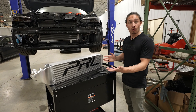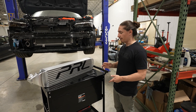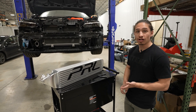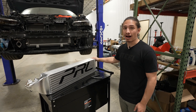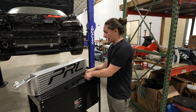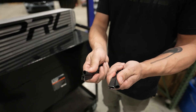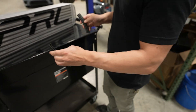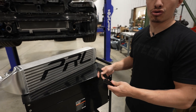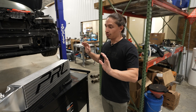Now we're at the most fun part of the video — the intercooler. Something really cool about this intercooler is that it utilizes the factory O-rings and the factory bracket, so the only extras included in the kit are the intercooler itself and these two sealing strips. These mount to the inside of the bumper and create a press seal against the intercooler to channel as much air through the core as possible. I'm going to show you how I put those on and what the intercooler looks like on the car.